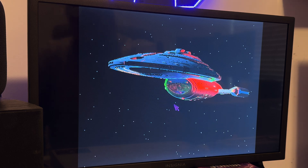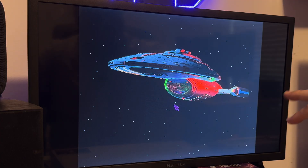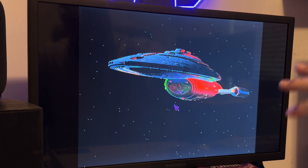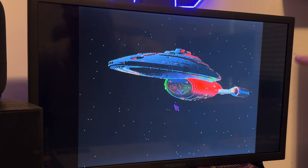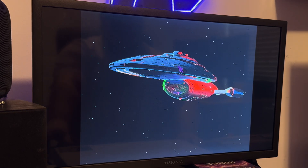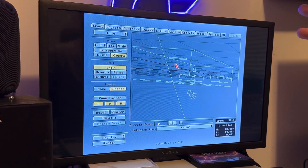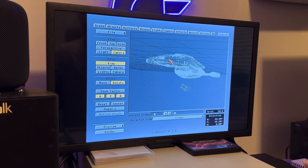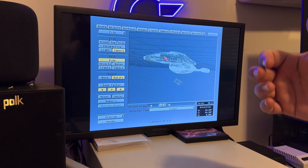And there we go - as I promised, the clown-colored Voyager original production model. What's happening is all the little point lights - these tiny slates that cast light onto the ship - all their falloff values, how the light gets dimmer the further it gets from the source, are completely out of whack. So yeah, we've got this wonderful-looking clown Voyager. But there it is - the original Voyager loaded on this 4000, thanks to the awesome power of that Gotta Go Fast RAM expansion card and Kazanov's 64. Thanks again for putting that together. Chris Edwards, thank you for figuring out the IDE cable issue. Now we have a CD-ROM drive, everything's working, and we have an always-boots Amiga 4000 to go along with the always-boots Amiga 3000. Thanks for watching.